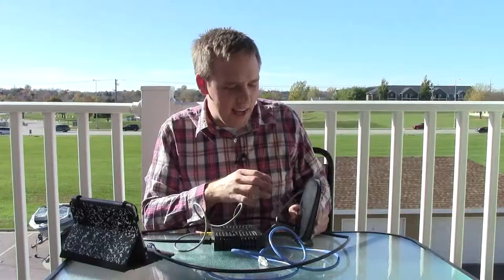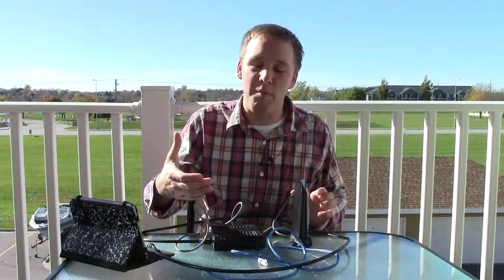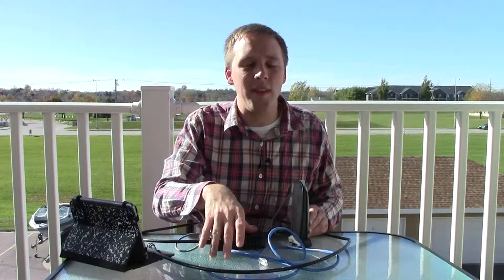For some people this is actually one of the last steps right here. Configuring wireless networks has gotten a lot easier over the years — if you power on your computer and scan for wireless networks you might even see this Belkin wireless network show up. Depending upon the type of router you have — Linksys, D-Link, Belkin, or other generic routers — you may be able to power on your computer, find the network, and then it's going to take you into a series of settings to set up the wireless network name and the password. Some routers may have a CD that you put into your computer to continue the installation process, so check your manual specifically to see what they want you to do next.